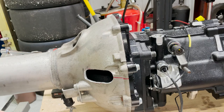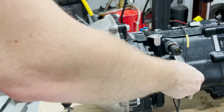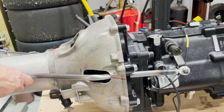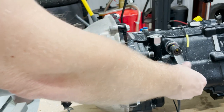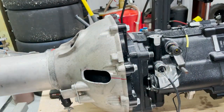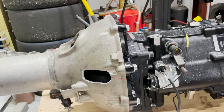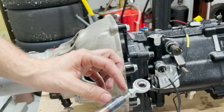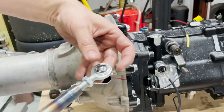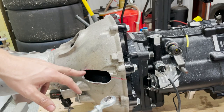Let's see what we've got now. I think I'm to the point where I've got a good spot. I need to go ahead and measure it, get it welded up, and then fine-tune that. I'm not going to clean up until we get this rod measured out. I want to have adjustments — the rod is all the way in right now. I'm going to figure out how long it needs to be, give myself about this much adjustment on both the back and the front, then get it pressed in, weld it up, test it all, and open this up more if I need to.